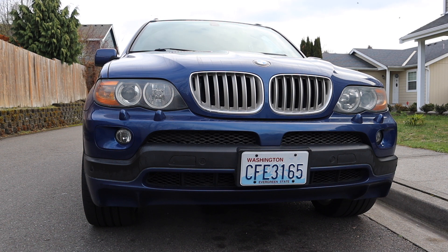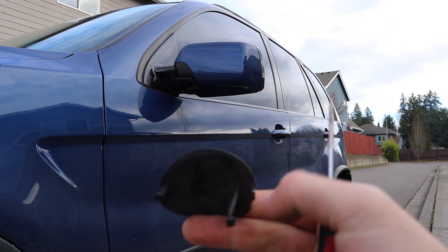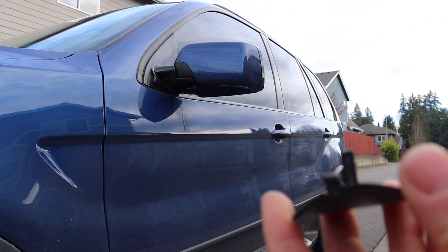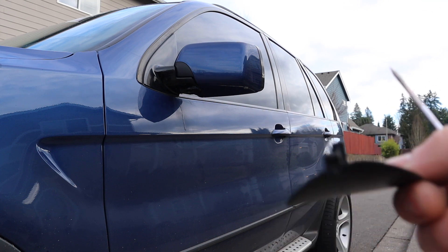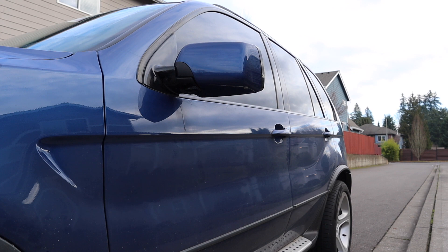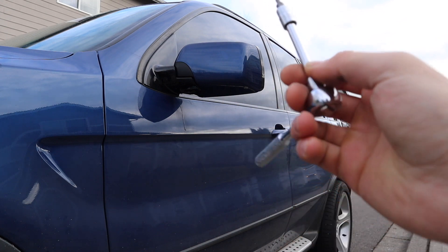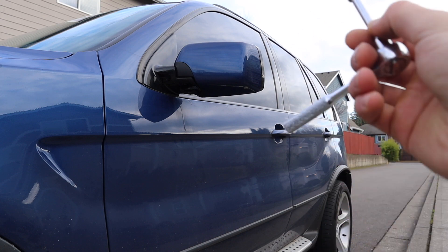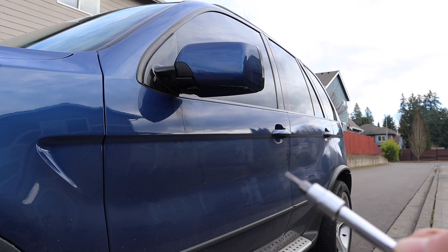Once I get the black grills, that's when I'm gonna take the front license plate off. So I did pop the cover — it's pretty easy. It has a longer tab and a smaller one, so you get a tiny flathead screwdriver and just pry it up and it pops. It has T15 torx bolts in there. I'm gonna try to torque them and see if that fixes the floppy mirror.